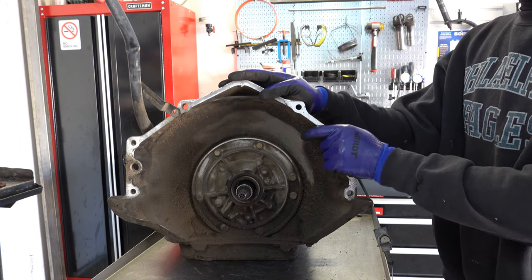And I typically always retro them back. The one other thing to note is that the two pistons are not interchangeable between drums. With the steel apply piston and its respective drum, the area where the piston sits is physically smaller in diameter, so you can't retro an aluminum piston. Plus, the older drum has a bleeder ball somewhere on the surface of the drum, but not the piston. The piston doesn't have any bleeder ball in it. With these aluminum pistons, they have a little bleeder valve or bleeder ball.